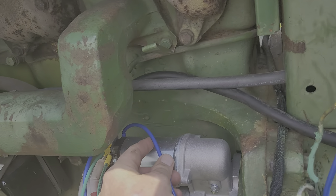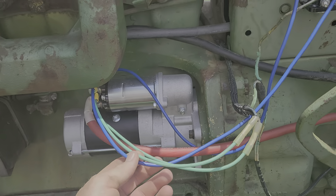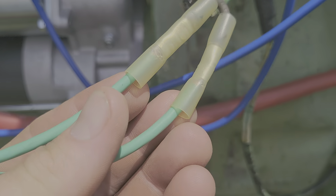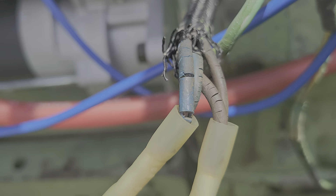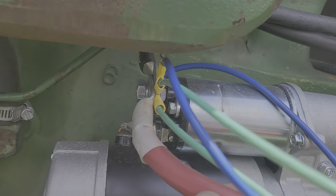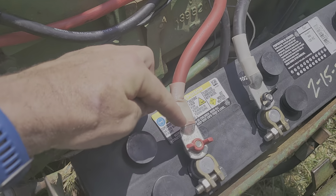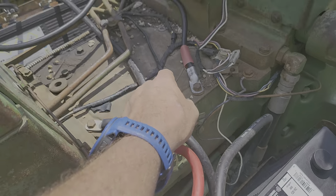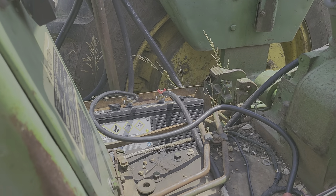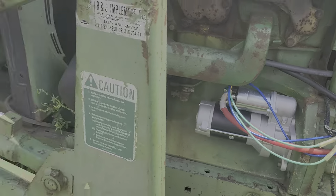On the left side of the solenoid here, that traces back to the S terminal basically on the starter. The right side goes to high, as you can tell. I've got two wires that I've patched in — those were the brown and the blue — the instructions put those up there. Then I've got the black and the red: positive and negative. I just used the cables I had. Those go to positive and negative — negative goes off to the chassis right here as you can see, and then the positive comes up here — but that is not working.